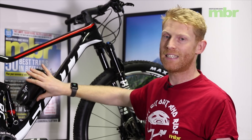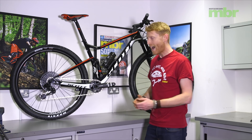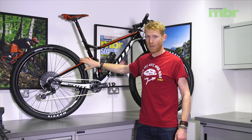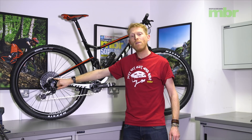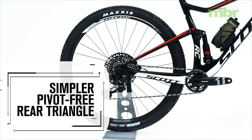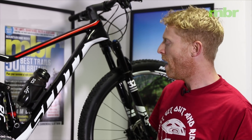There's a completely redesigned rear triangle. The old Scott Spark had a rear triangle made of about 18 different pieces, adding weight. Now it's made of only three pieces, so they've dropped about 130 grams off the overall frame weight just by changing that rear end. There's no pivot at the rear end, so they rely on the flex in the seat stays. The rear brake is actually mounted to the chainstay to allow the complete seat stay to flex freely. Even the linkage plate is now full carbon, so pretty much the whole frame is a carbon fibre construction.